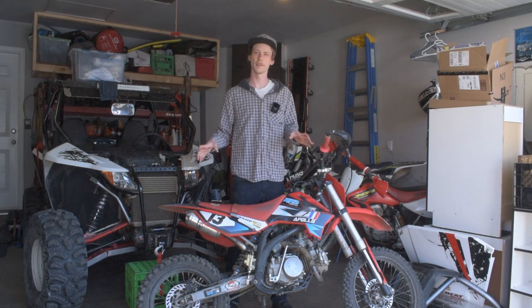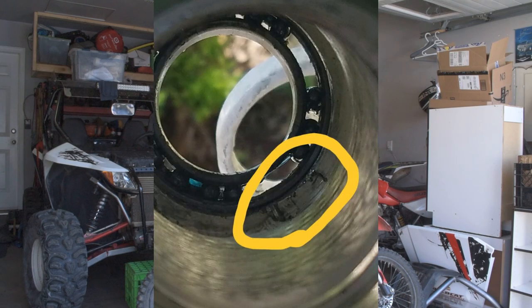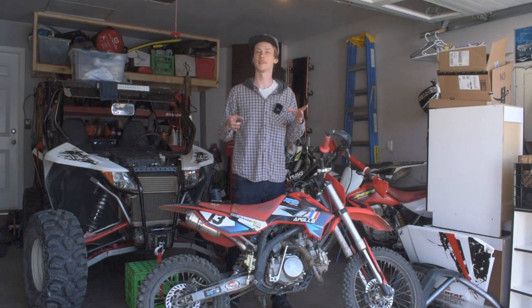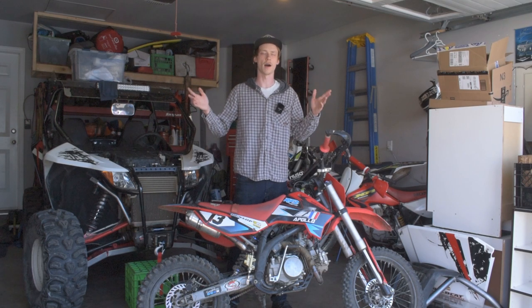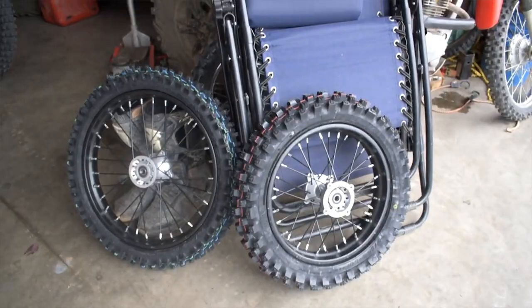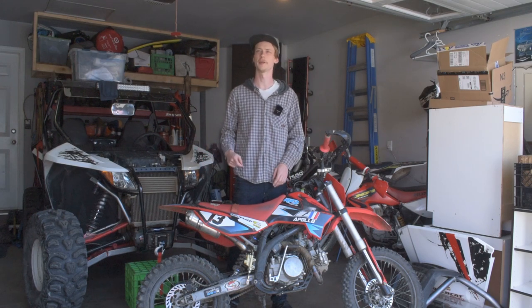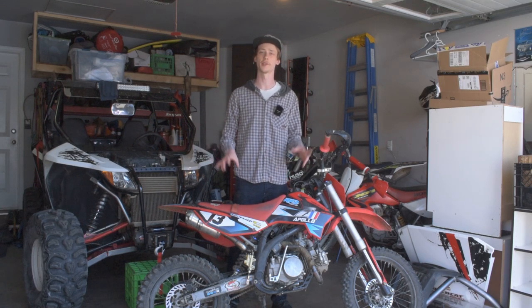An issue I had with the original wheel set — the 14 front and 12 inch rear — was that the hubs would warp out, causing your bearings to wear out prematurely. When the hub is warped, you can't just replace a wheel bearing and be good, because the bearing no longer fits tight in the worn hub. The rims on the smaller diameter wheels also dented extremely easily — hit any rock ledge and you'd guarantee putting a big dent in the rim. They looked like octagons by the time I swapped them. The spokes constantly came loose as well — a nightmare to deal with.